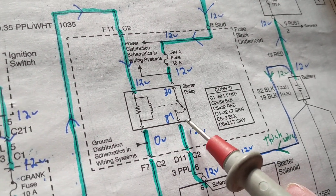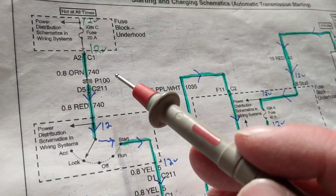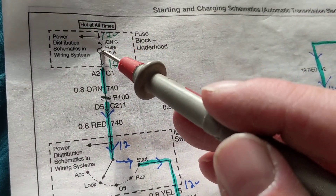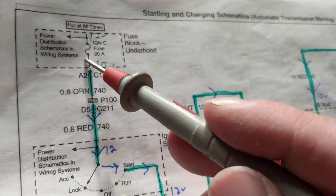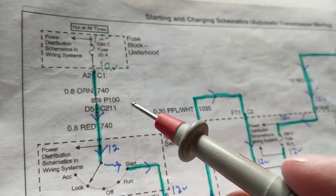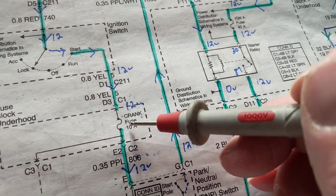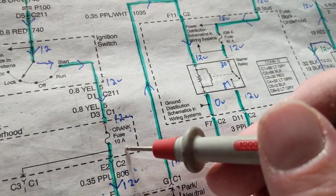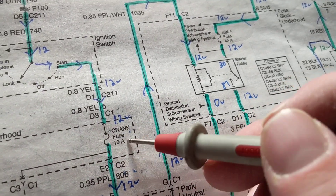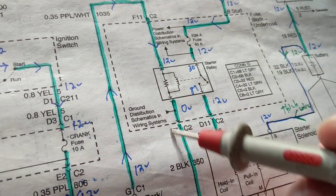If I'm not sure whether the circuit is functioning, I take out the fuse and put a meter or a clamp meter in place with a wire — knowing it's not blown — and measure current with a clamp meter across that wire. Or, if it's safe, I take this meter on the current setting and place it in that position to measure how much current is flowing, which tells me if current is flowing through that path.